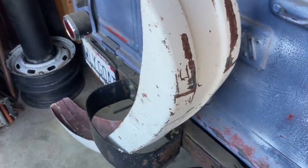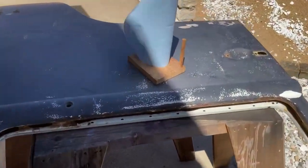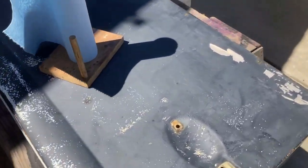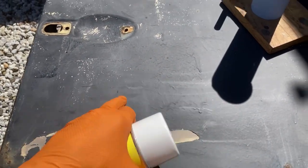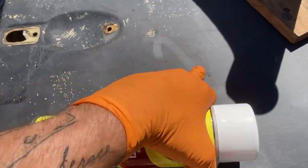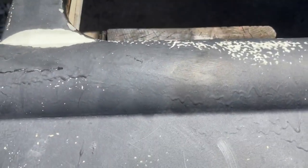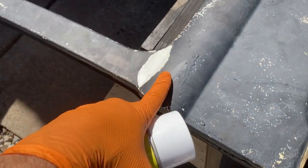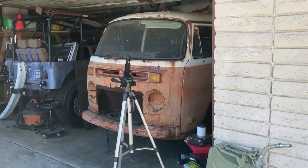Just using this goof off and then you scrub it. To neutralize it, you come back and scrub it again with a lot of water and it rinses off. That is the plan here. I am confident I'll be able to get it off without too much damage. Where it might be worn through, this is going to get painted orange. You can see right here the runs are terrible — a whole bunch right up in there. But it's white underneath, so if I can get through the black, preserve the white, give it a little polish, paint this section orange, it's going to have the same faded look as the bus itself.